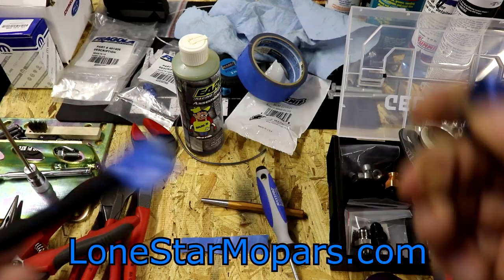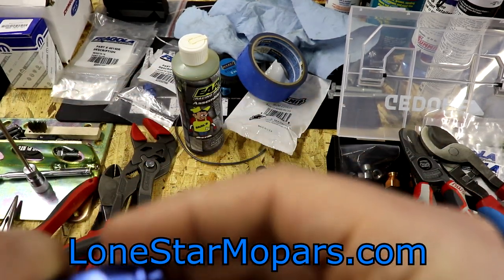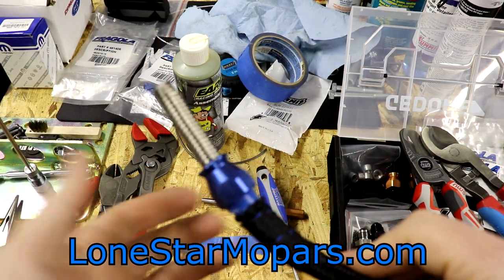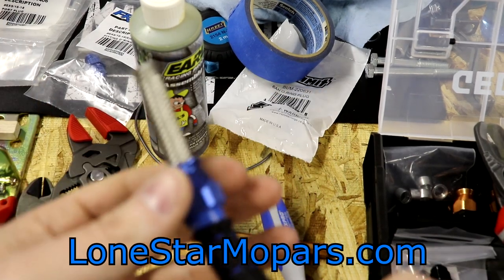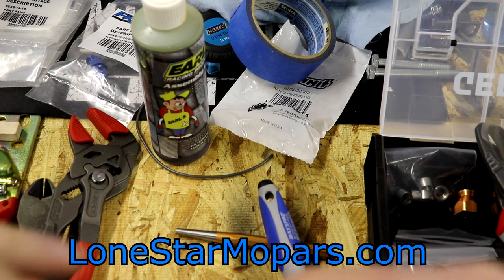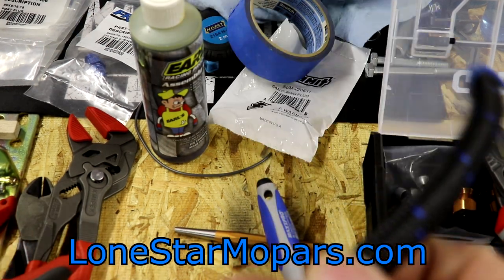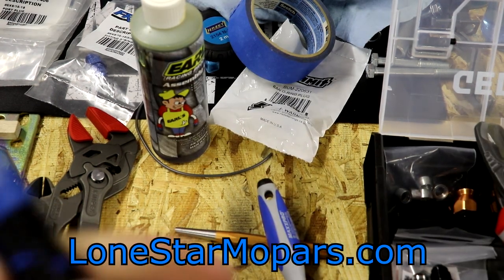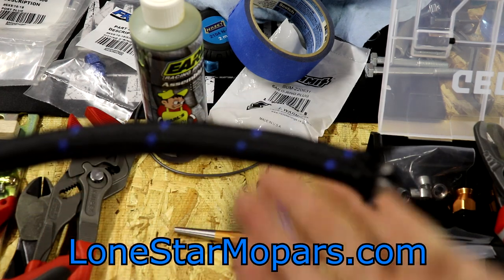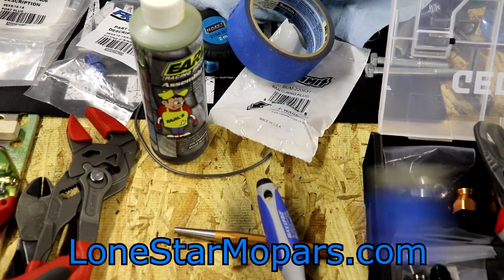When you backdoor things, you need to make sure they're oriented properly. Before we do anything with this side — which we may trim back — we'd want the nut oriented like this. But with this one, we want it oriented this way because it's essentially going to come here, collapse the ferrule for the seal, and thread in. Oh no... okay, this is bad. Did not know this was even possible. We just scrunched the whole thing — I did not know you could do that. The hose is probably too short now. Very odd. Since it's pretty late and the battery is flashing, we're going to go back to the drawing board.